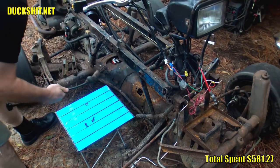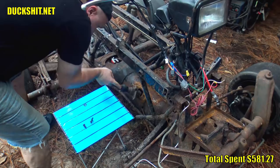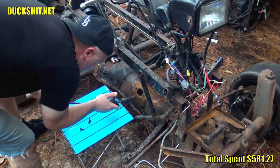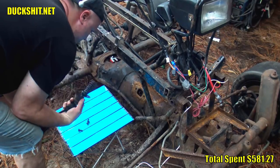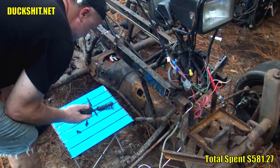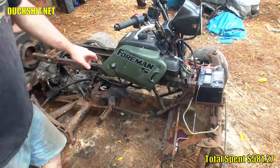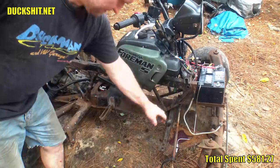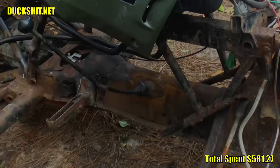Upon comparing this to a Beetle shifter, I found that the ball was about 3/4 inch lower on the bottom of the shifter. Since I had to cut it anyway to reorient the factory bend, it's not really a problem for me, is it? I guess not. So I cut the ball back off and removed a little bit of the rod, then tacked the shifter back together in a few places and tested it. It seemed to work pretty well until the ball broke off, and that's annoying. But it just needs proper welds, so off the shifter came yet again.